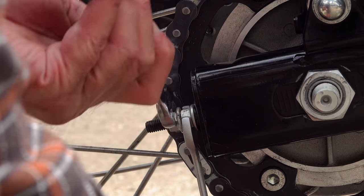Now, using a piece of cardboard, lube the bottom run on the inside of the chain, using the cardboard to protect bits that you don't want lubricating, until you've put a medium coat on the entire length of the chain. Now, most videos and books will tell you to lube the chain on the outside around the rear sprocket, but I've got an issue with this.